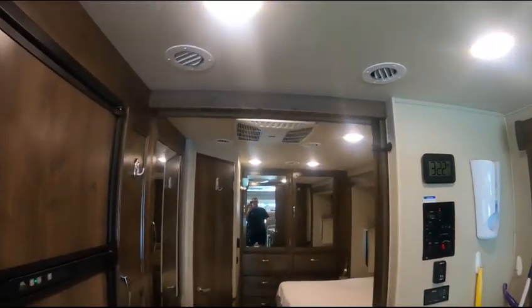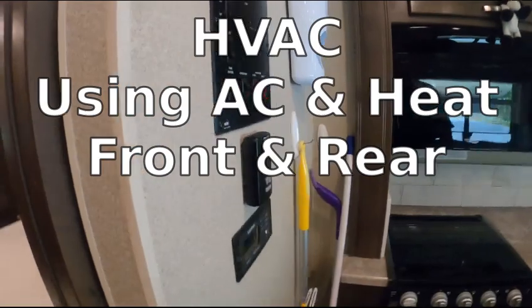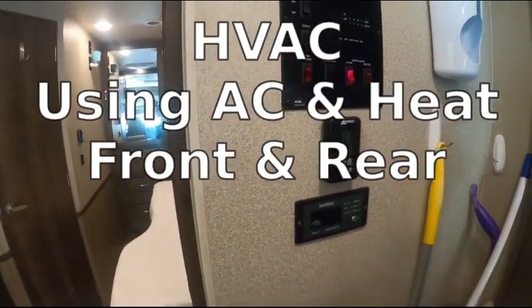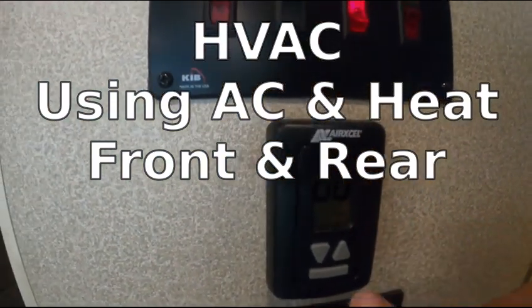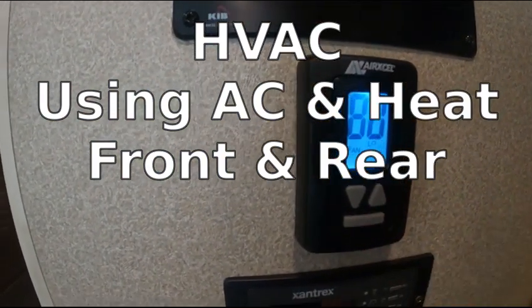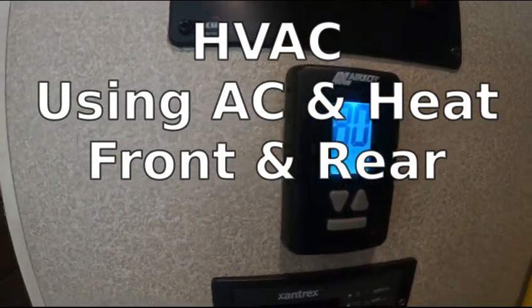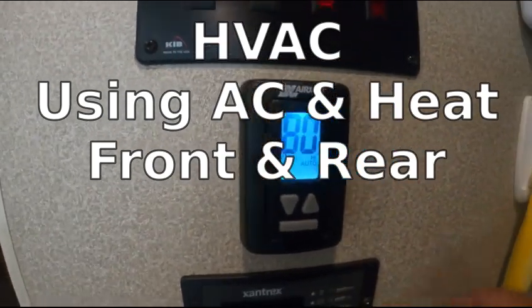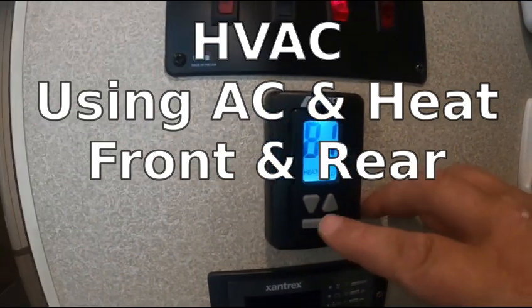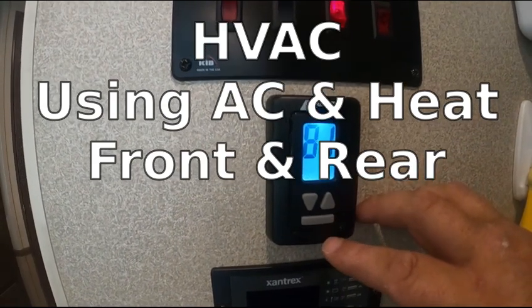So the back one is a 13,000 BTU air conditioner, and the front one is a 15,000, so it's a little bigger. So what we're gonna do is let's turn on our front air conditioner. It's much like your heating systems at home, okay? See if I can get a good focus on there. There we go. One button is off. Fan. Fan high. Cool high. Cool low. Cool auto. It'll turn it on and off. Cool high auto. Heat electric. That's heater in the air conditioner. Heat gas. That's the furnace I mentioned earlier. And then back to off.